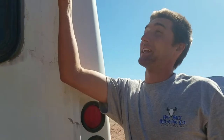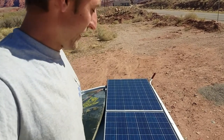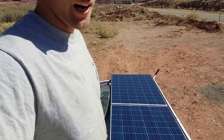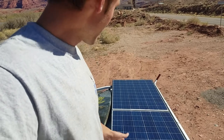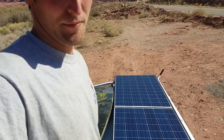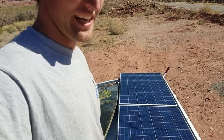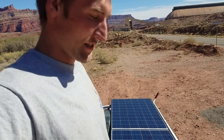The next form of power generation is the solar system — let's go up to the roof. There are two types of solar panels relevant to van and bus conversions: 36 volt panels, which normally go on houses, and 12 volt panels, which are more easily connected to a 12 volt electrical system. I chose 36 volt panels because they put out more power and I found it's cheaper to build a high-power solar system with them. I bought these panels second-hand; they were four years old and I paid $59 each. To run this type of panel, we need to talk about charge controllers.